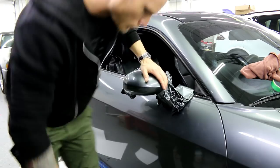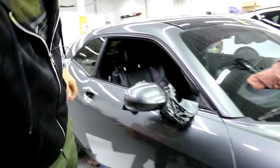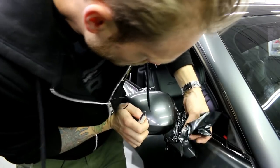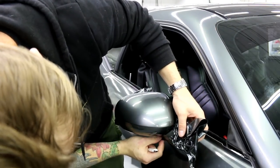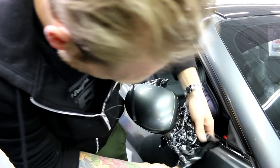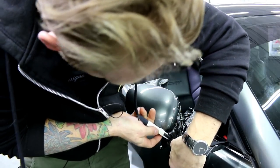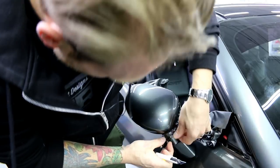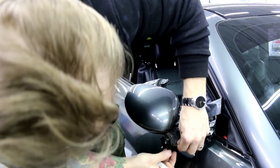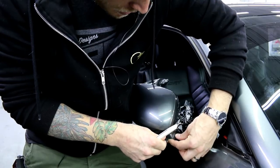I do have to let it cool a little bit. Now I'll put the camera in a little bit — I'm going to pull the knifeless tape on the inside so you guys can see. There's my knifeless all bunched up down there, but it's fine. I'm going to cut out some of this because you don't want to try and pull the knifeless tape through all these wrinkles. I'm going to flatten it out before the knifeless tape so that when I pull the knifeless tape right now, it's got a nice way to cut.